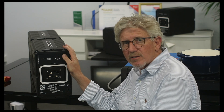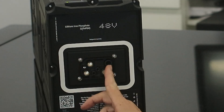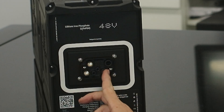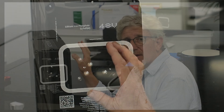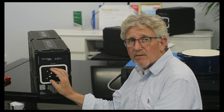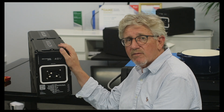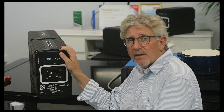When we designed the media battery, the plug was the most important part. It has two steel pins that you can see here that locate the plug, plus a waterproof grommet that goes around it. The battery is IP66 rated, and the plug is capable of carrying four channels at 150 amps each — so in 48 volt that's 7.5 kilowatts, and up to 2 kilowatts on the 12 volt side.